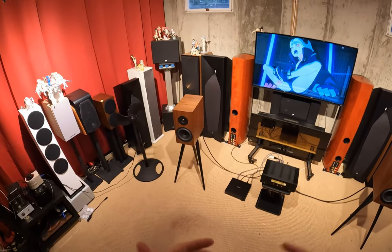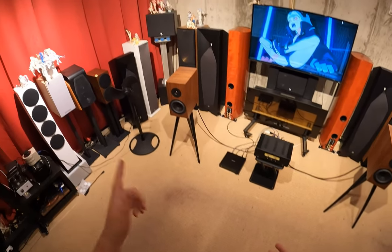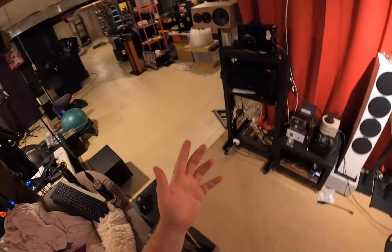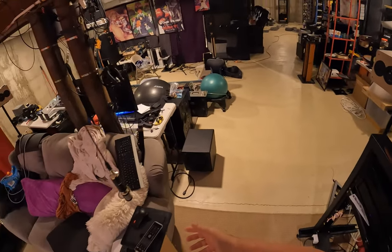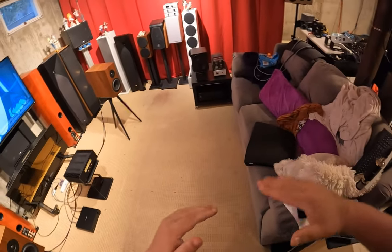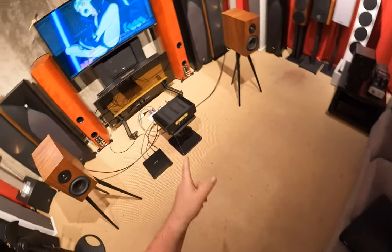A lot of the older vintage stuff I have here — this Pioneer VSX-D1S, this Japanese-made one — it's Class A-B. It means when there's no sound playing, it shuts off, or at least lowers the power consumption. Much newer stuff — Class D and Class H — is even more efficient where it barely draws power even when sound is happening. It's wildly efficient. So this is still sort of old-school tech.